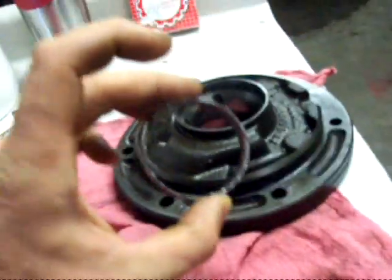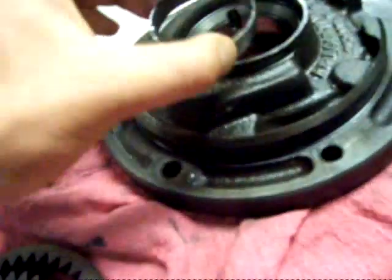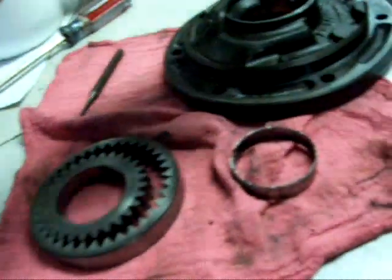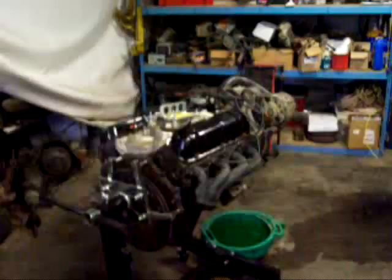As you can see I've got the pump apart. I've got the bushing out and the seal out. The seal just pops out with a screwdriver, and then I tapped on the bushing with a punch — just tapped here and then tapped here until it came out. I've got my new one; I bought a couple of these in case I screw it up. I'm going to clean this all up first and then install it. Hopefully I can use this cam bearing installation tool. Big rod there and pound it in — we'll see what happens. I've also got the bearings for that engine, so I'll be tearing that down soon enough.